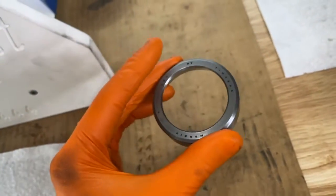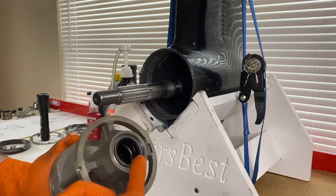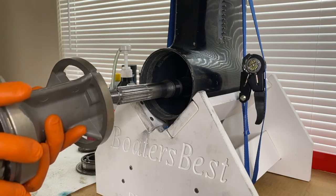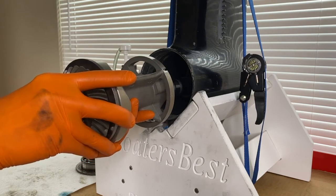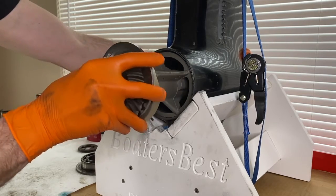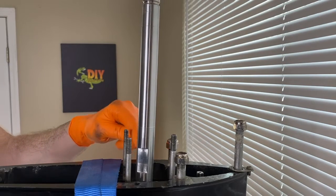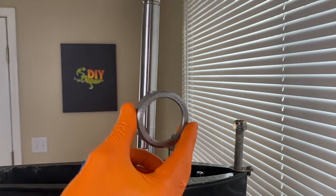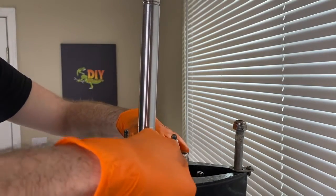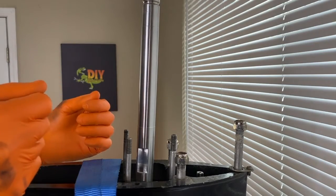This is the top bearing race or carrier that is going to go up top on the actual bearing. I've got the new bearing carrier, thrust ring, and reverse gear, and I'm going to lubricate the inner seals. We are going to install this bearing carrier backwards - this is going to do two things: stabilize the propeller shaft as we tighten the pinion nut on the shaft, as well as apply pressure to the tool to alleviate it from shifting off that nut. It is now in and flush with the tool. Back up top, carefully shift the carrier over the shaft and align it inside the cavity over the bearing - it rests right in place, flush with the top portion of the bearing.